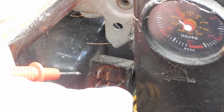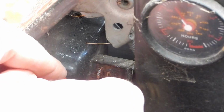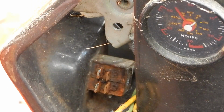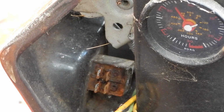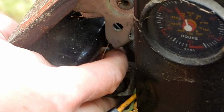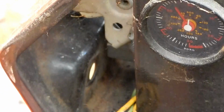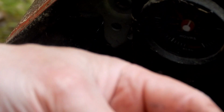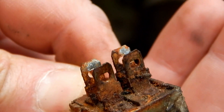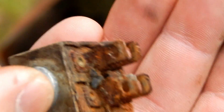This is a double pole switch. It does 2 things. So in one of these positions, I should get continuity between here and here. And I don't at all, so unfortunately I think this switch is junk. Voila. Well, that's looking crusty. Crusty, dusty. Yeah. That does not look good. I will try and clean off the terminals though, and just try one more time.